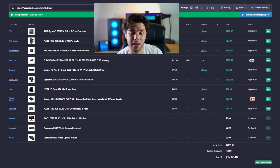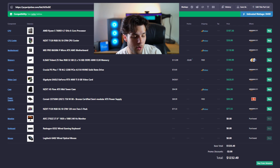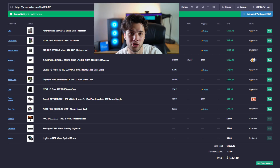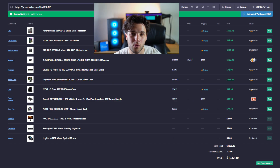The reason this system isn't good for the price is mainly because of the NZXT aesthetic — spending so much on aesthetics meant ending up with the RTX 4060 Ti, which I do not like, especially the 8GB version. Since you want to do video editing and 3D rendering, I just wouldn't recommend 8GB of VRAM for 1440p resolution, even for just gaming. If you were only playing Valorant and CS2, 8GB is fine, but with all the extra workloads, I wouldn't recommend it.